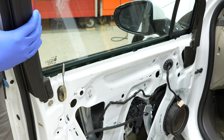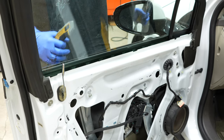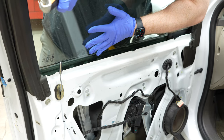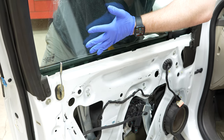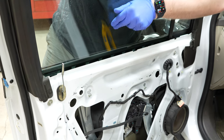Now very carefully remove the tape off our window — hold onto the window as best you can, then cut the tape so the window can come down. Do not let go of the window. You might even want a helper to hang on to it or to cut it, because if you let go right now the window will fall all the way down and break into a million pieces.